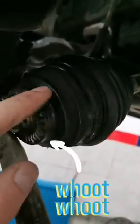The driveshaft should now be free. We're gonna remove it from the back side. We have some cable here for the ABS sensor — we don't want to break that. So we just push the wheel hub assembly away. And here it is — the driveshaft is out. Fairly simple, pretty much simpler than the older models.